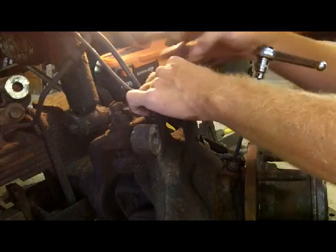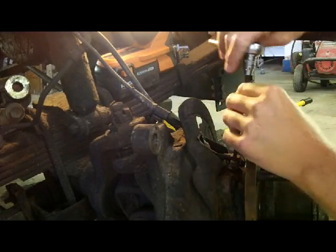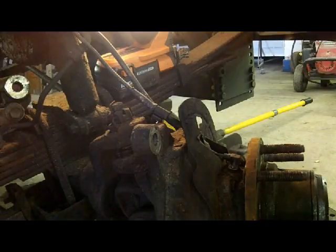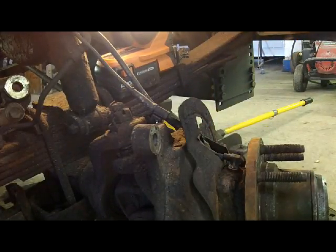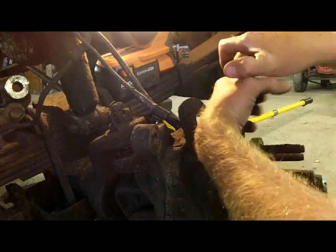We're going to take off the bolt that holds this cable up here — I did sort of pre-loosen these; they've been off recently so they weren't tight. These are Harbor Freight Allen keys. I don't recommend the long ones — I wish I would have found the short ones, because the small ones have too much give when they're too long. Sometimes these spin right out, other times they don't. I've actually had to pick a broken off tip out of there before. I would prefer not to break that sensor, because if I can't get it out, then I'm buying a hub bearing, which is expensive.